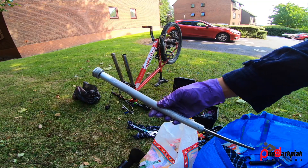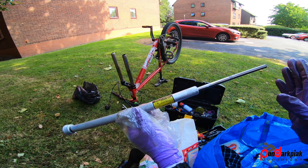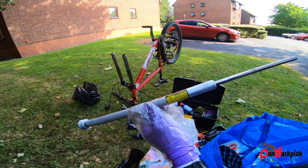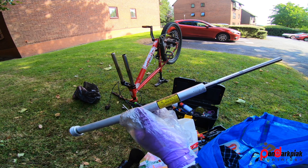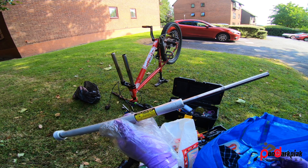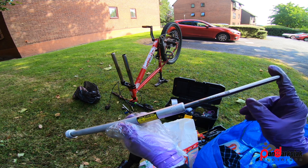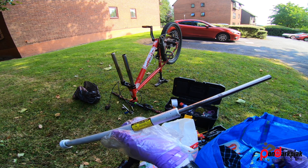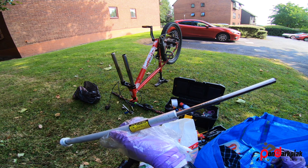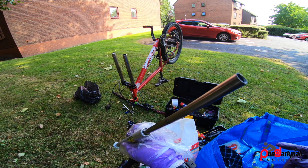So I was right about my hypothesis. Basically this damper wouldn't retract all the way — it's supposed to go at least 100 millimeters because this fork is 120mm, but let's say 100 for simplicity — so about 4 inches. It's supposed to retract 4 inches, but it seems like it wouldn't go over about 3 inches from the mark I've made here. That's exactly what happened because I felt the harshness when I hit a 2-3 foot drop at the university.